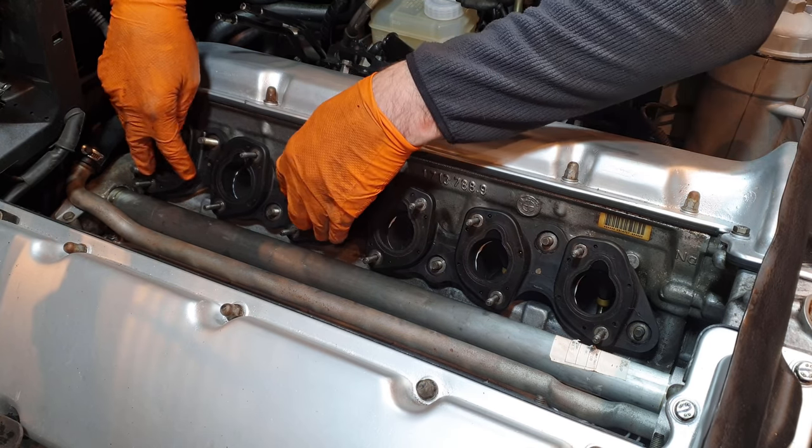Starting at the bottom: cylinders five, one, three — the ignition coil — six, four, two. I'm also swapping out both ignition coils — two brand new Bosch units, one on each side. They slide off the welded mount and the two 10mm terminals come off pretty easily.